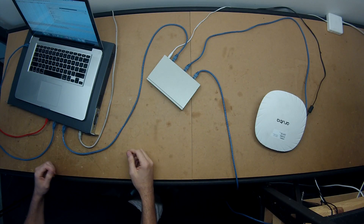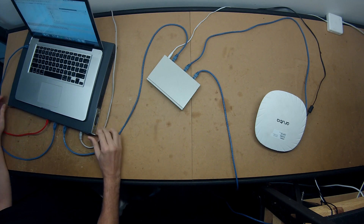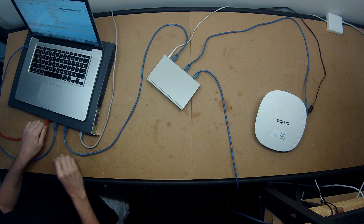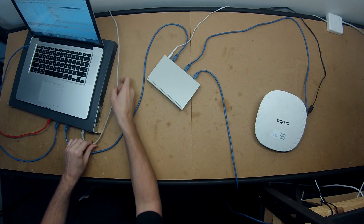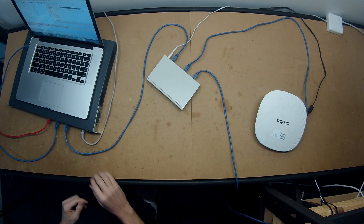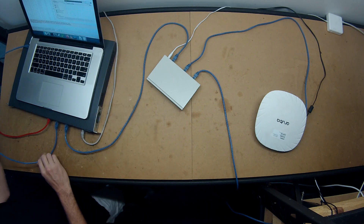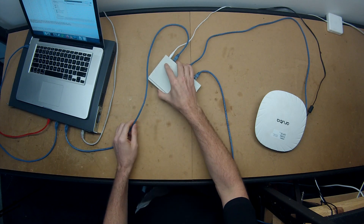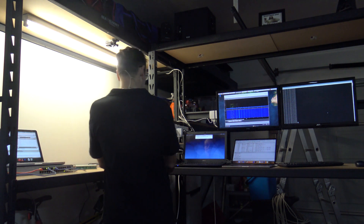First I'll go through what I've got on the bench. This is the main HP switch I'll be using. The red one going in is the multicast source — that goes off to the Raspberry Pi. The cream beige colored one goes to my network so I can connect to it, gives it its gateway, and provides DHCP. I've got a couple of ports in use here, one going through to a dumb switch, then to an access point and also a wired host.